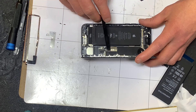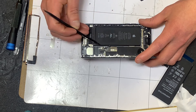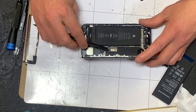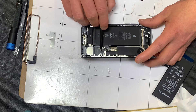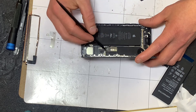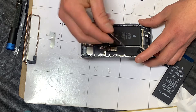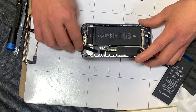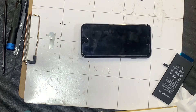This is one of the most important things you can do when working on a phone — you have to disconnect the power. On the iPhone 7 you can trace the flex cable out of the bottom of the battery and just disconnect it. If you were to look at this motherboard — it runs from here all the way up and over — under a microscope there are hundreds of little resistors, capacitors, and chips that you could potentially knock off the board. So when you disconnect the connection, you just get the very tip of the connector and flip it up gently. You don't want to dig — that could cause you a lot of headache.